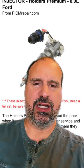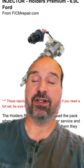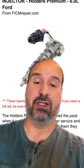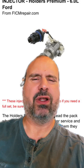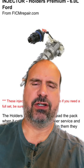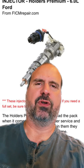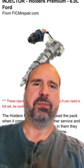Now you have 15 seconds on, 45 seconds off — unless you want to buy a starter. We had somebody say they'd been cranking for three minutes straight with no problem. I don't know, you must be living right, because we've burnt up a lot of starters over the years. So 15 seconds on, 45 seconds off. If you follow that, you will not burn up a starter, and you will not send voltage to anything but the starter.